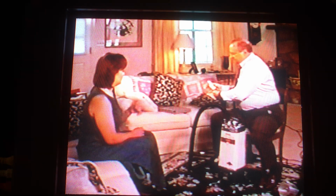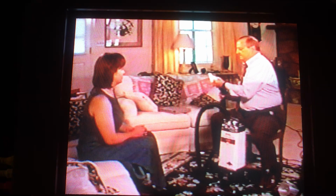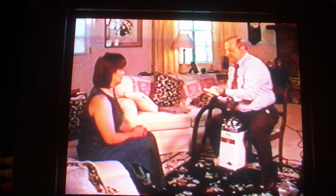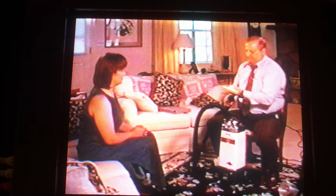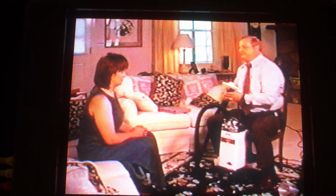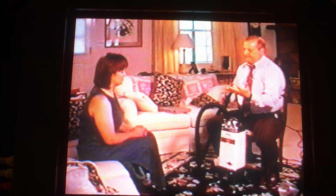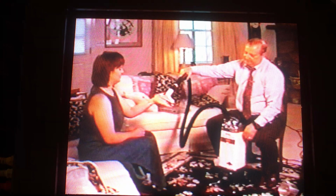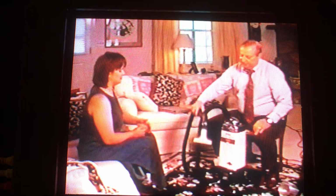I'm going to put this on here, and we're going to take our upholstery tool. I've got the equivalent of your vacuum cleaner now. As a matter of fact, I've got the equivalent of a Kirby, Electrolux, Filter Queen, or whatever. What I'm doing right now is I'm pulling air off the floor. You hear that air? Yeah. Now that air, that's what picks the dirt up. As you go over the floor, that rushing air pulls the dirt into the bag. The air goes through the bag, and the dirt's supposed to stay in there.